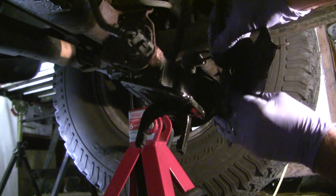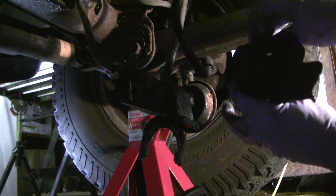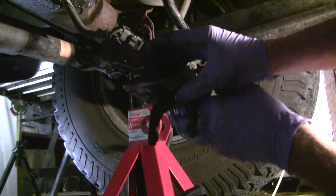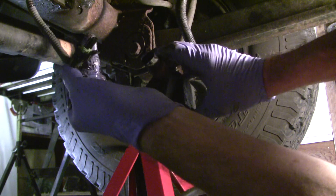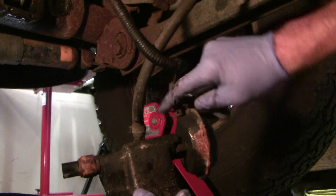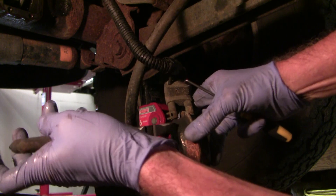Let's take some of this stuff off here. This thing comes off, and then this electrical connector we can take off and put that out of the way. Got the vent tube free up top, and as far as these vacuum tubes go, it looks like there's little pinch connectors here, so I'll just work on loosening these off.